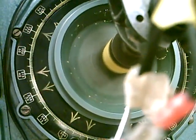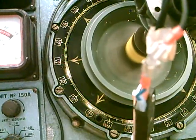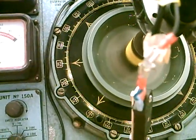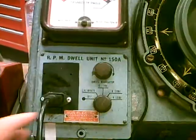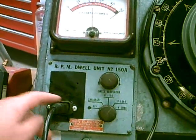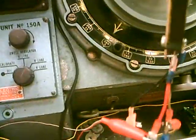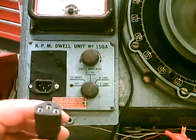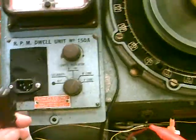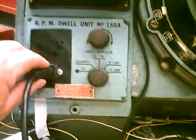You can switch it in and switch it out when you're uncertain. We're working with a lot of these electronic modules, so it's good to have something that will actually verify what's happening. On this unit, typically what you have is a lead that goes to the points, but there are all kinds of electronic ignitions. So I put in this second connector here to tie into our HEI unit. This is actually a standard power plug — if you don't plug this into a wall, these are a really cheap way to hook things up. Everyone has a bunch of these power cords sitting around. You can set one up for each type of distributor and instantly plug it in.